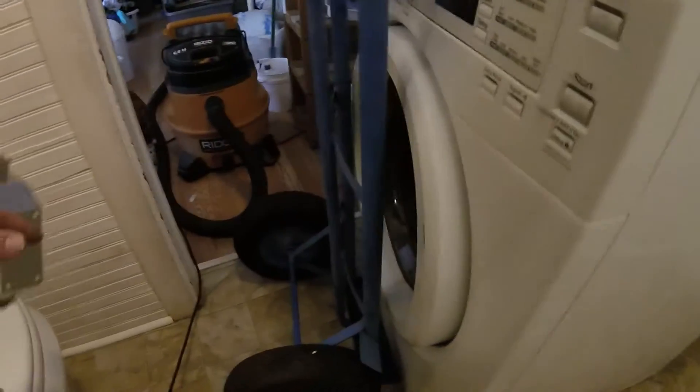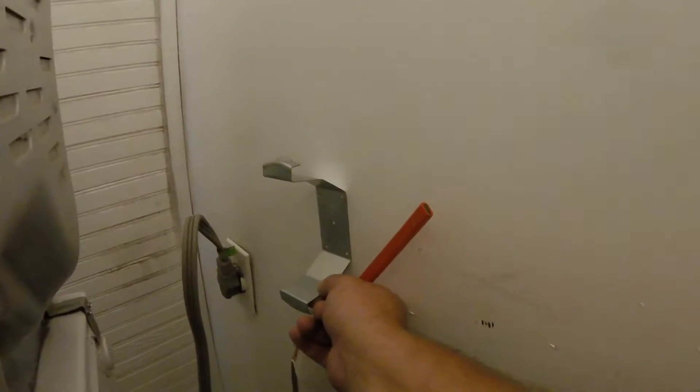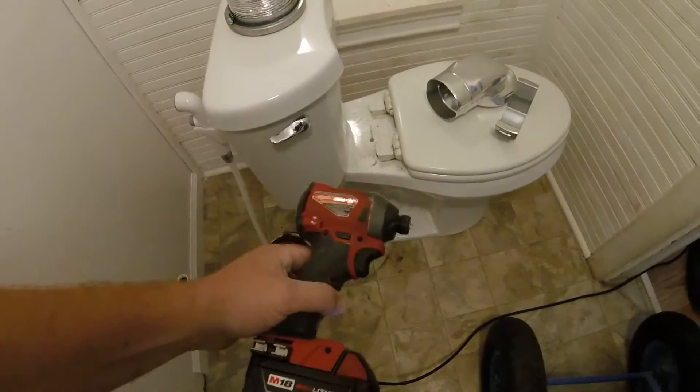We got our dryer scooted back. This washer and dryer are stackable and screwed together — they're very heavy. I used a heavy-duty hand truck to help scoot them back without tearing the linoleum flooring. We checked and found this position is good. We're going to line this up right here with the edge, hold it in place, mark our screw holes, and then screw it in with some drywall screws and drywall anchors because this is not on a stud — we know that because it'll be above the outlet and the stud runs right next to the outlet. We've also made sure our AC power doesn't run this way; in this case, that power actually runs down to the floor.